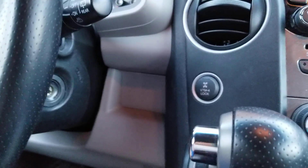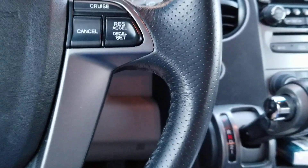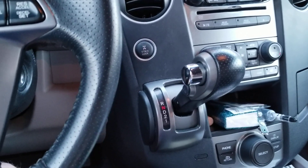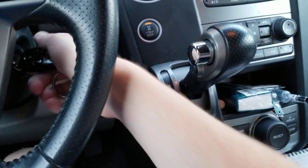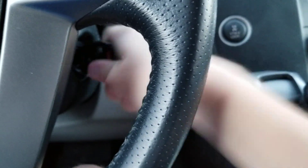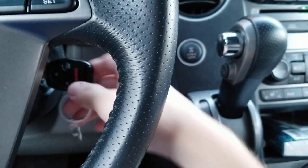I'm going to guess that while the car is cranking, it temporarily disables the interlock, so that the key can be removed while the transmission is not in park. Let me try this — if I put it in drive and attempt to crank it over, I can't pull the key out. So there you have it.